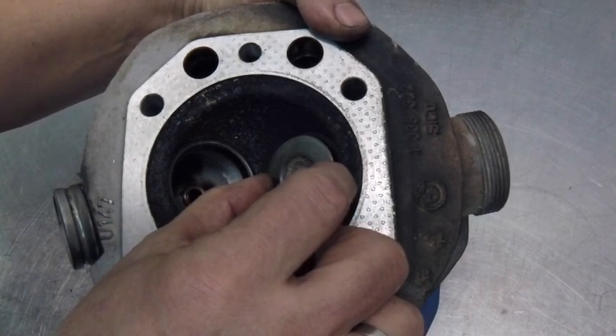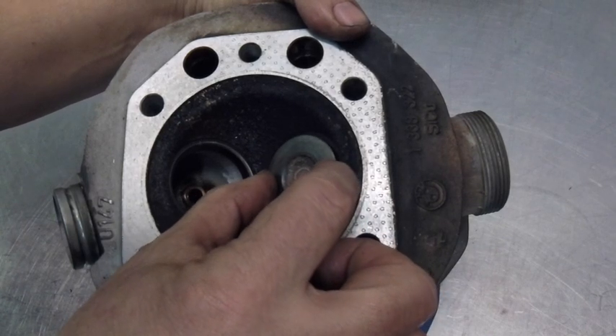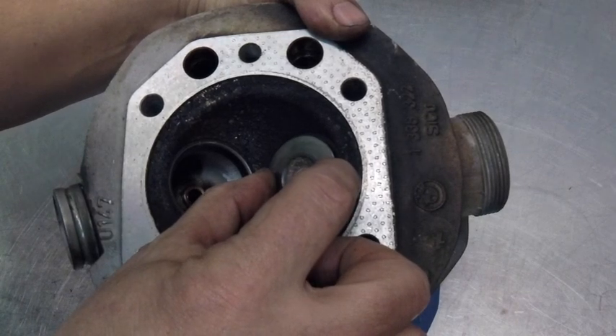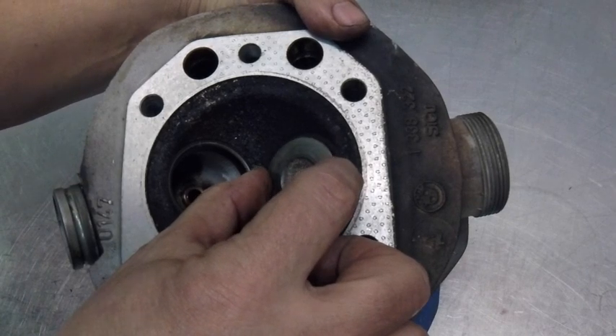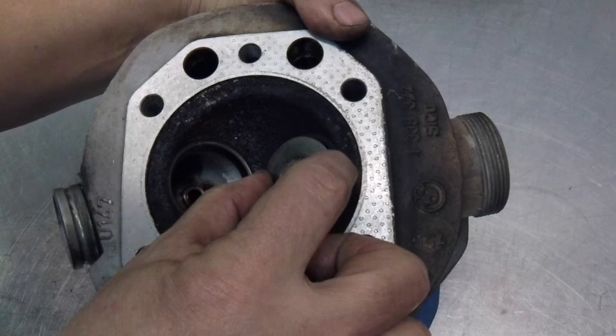You can look at how much slop there is in this exhaust valve — something like a millimeter and a half or two millimeters of slop. I measured the guide. The guide should be right around 8 millimeters, and the top and bottom on this one are worn to 8.4 millimeters, which by valve guide standards is something you could drive a Mack truck through.